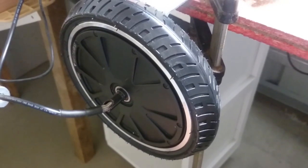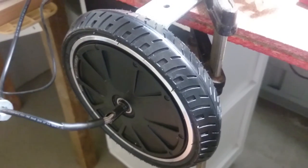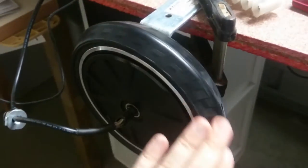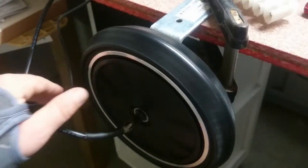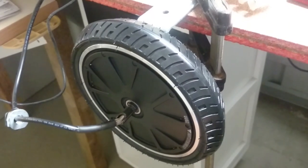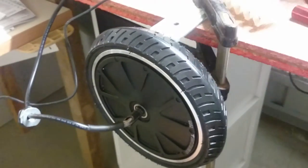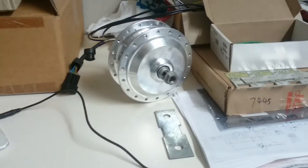Certainly not like the Razor chain drive scooters that you see cruising around the streets. I have noticed that it's actually quite difficult to turn when it's stationary. There's a definite electrical resistance when I turn it in the direction of motion; if I turn it against the direction of motion it's a lot more free. So whether or not that's something to do with the software I'm not sure — I'll have to ask Lebowski about it and see what he thinks. Perhaps if I redo the calibration it'll come good.